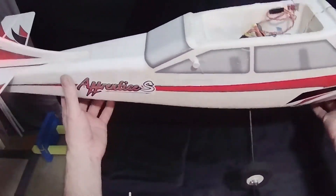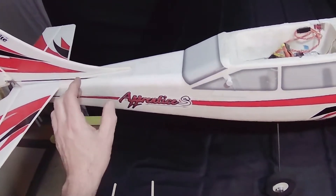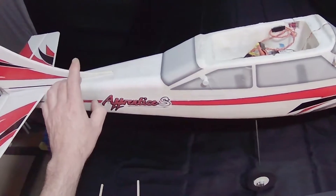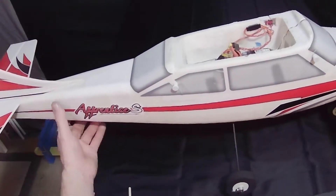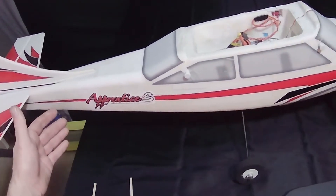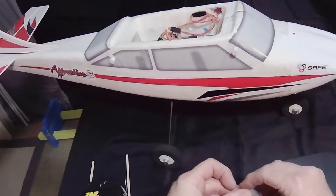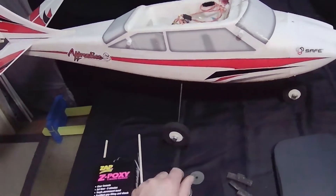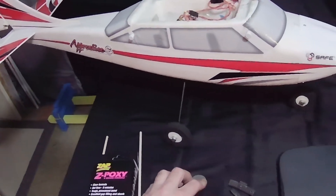There's a seesaw effect, a teeter-totter effect going on. The center of gravity is about here where my right hand is. If you put just a little bit of weight back here, you have to add a lot more weight up front to counteract it. It's not teeter-tottering on the rear wheels — it's teeter-tottering right here. Just the leverage: put a half ounce right here and it's going to take several ounces up front. He had a handful of washers for a test, and figured he had about two ounces of weight. So how can we come up with two ounces of weight to go in this plane safely and still look good?